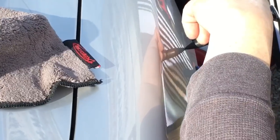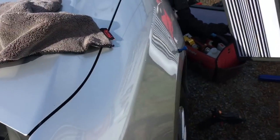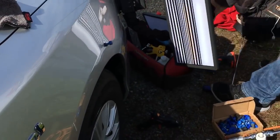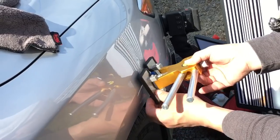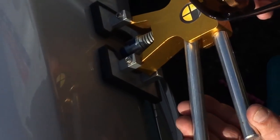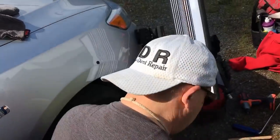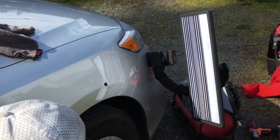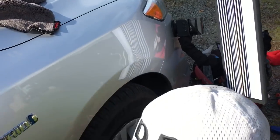These are just the ones I'm gonna have to come through and tap until they're straight. Let's make that pull — I'll use the mini lifter. I'm not worried about crushing these brows, there's no way this is gonna do that. It's just one little tiny dent, but I wanted a real directed pull. Let's give it a snap. My little oil sprayer is starting to lose its pressure, and that's because I use isopropyl alcohol — it will break the seal after a while. I've had this thing for a good five or six months, maybe a year — it was a good eight dollars. I'm gonna tap the rest of these out. There's a little high spot — that's probably from a rock or something, it wasn't my pushes because I haven't made any pushes yet.